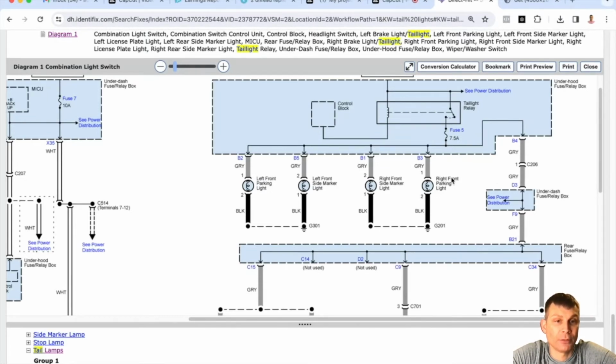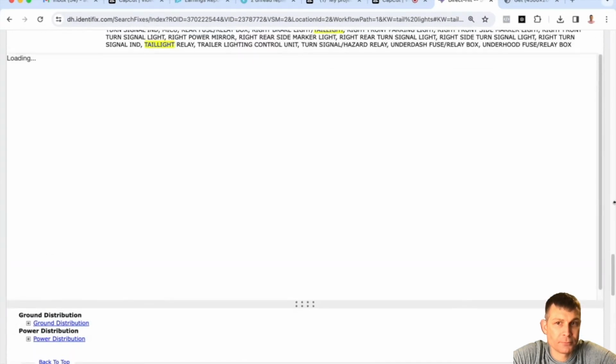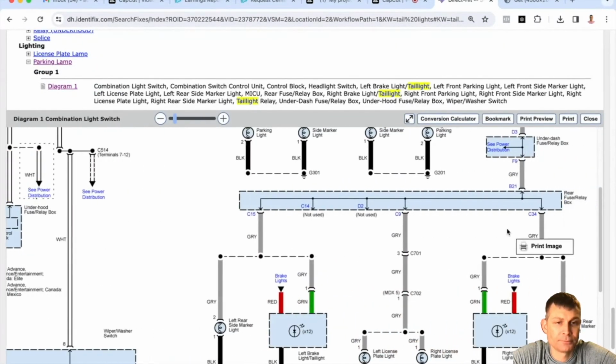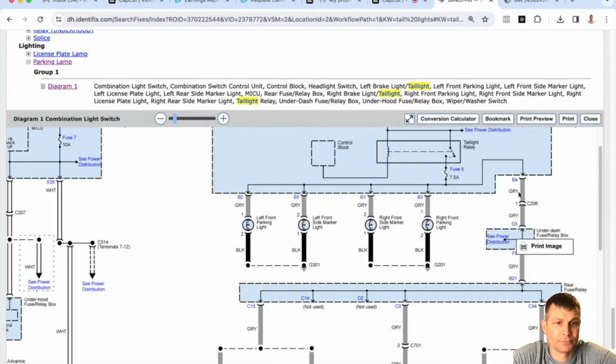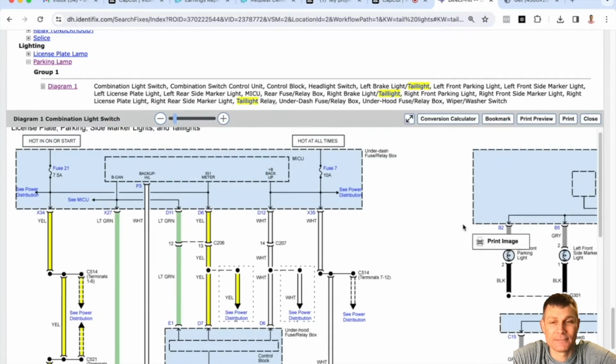My diagram is showing it's a gray wire from the fuse box. I know what happened. I screwed an accessory into the floor pan. That'll do it. A few days ago, I probably put a screw through a wire. Yep, that'll do it. Oh boy, so I wonder what my accessibility is going to be like, because who knows what I'm going to have to do. The first thing I can do is back the screws out, right? That might solve it temporarily. It'd be a good place to start.